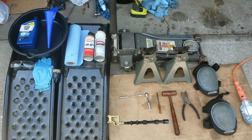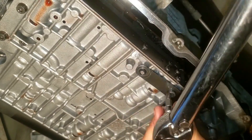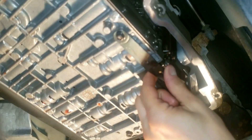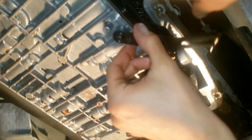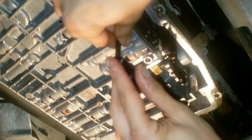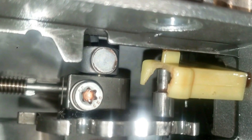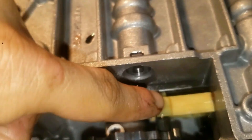Okay, back under the car. Just took the trans oil filter off. Grab a ratchet with a T30 bit to remove this bracket detent leaf spring — it comes straight up. Leave the alignment pin in, or remember to put it back in later. That bracket and leaf spring is off, and you can tell it's definitely broke. It's not flat against here, so that looks like it's probably one of the reasons for the problem.